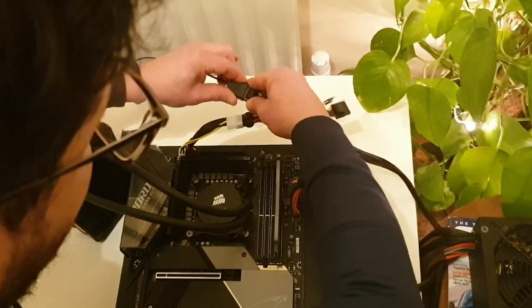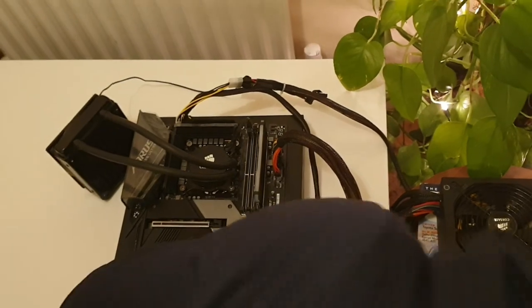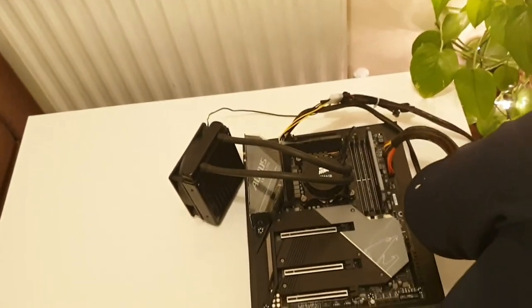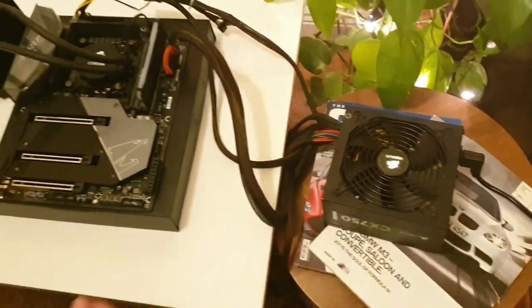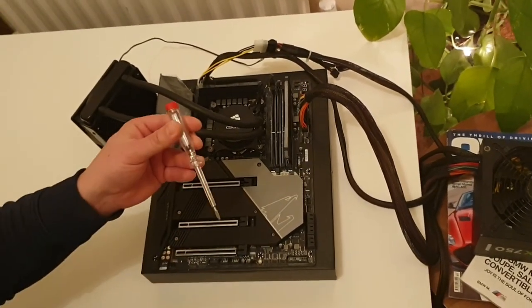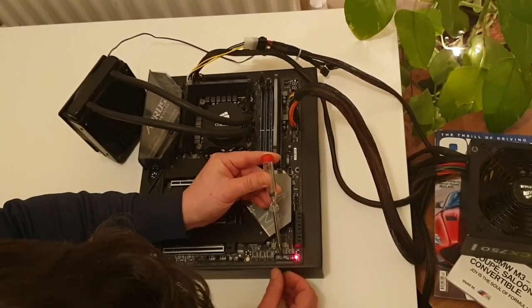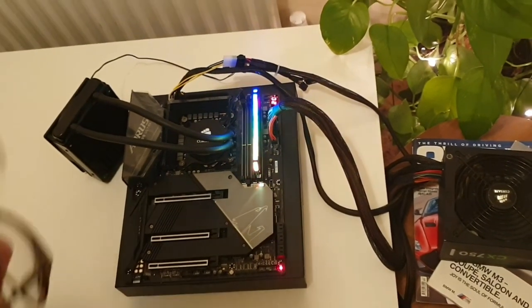Everything is ready and we are left only with the cooler for the processor. Switch the power supply on at the wall. Press the button on the power supply unit. We don't need any other pins or connectors. Just use a screwdriver and short the 3rd and 4th pins on the front panel socket. If you're not sure, just stop the video and zoom in.